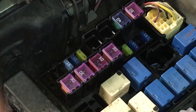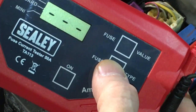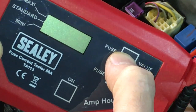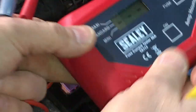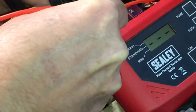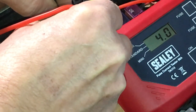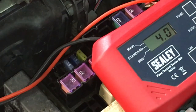So we'll check it on both settings and work the math backwards to see if our readings make some sense. Let me just turn the rig on — okay, fuse type is mini — select until we get the correct setting — we're in 15 amp mini. I'm just going to go across the two terminals. You can hear the tone, so it has taken the amperage — four amps, which is nice for easy math. It's telling us there's four amps through the fuse.